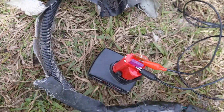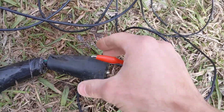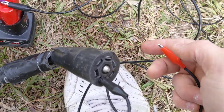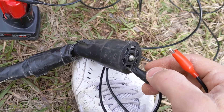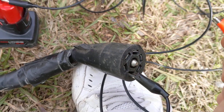So in this scenario, I'm actually testing my trailer lights. I've got my 7-pin connector here, and I know that this is my ground on the trailer, so I've got my negative hooked up to the ground. And then I can test different circuits.